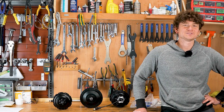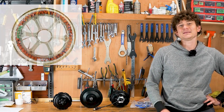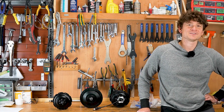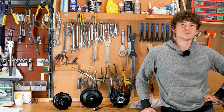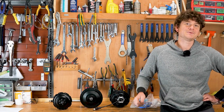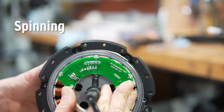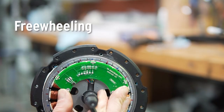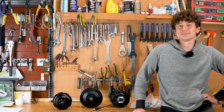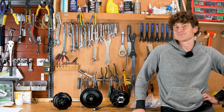The world of e-bike hub motors is broadly divided into geared hub motors and direct drive motors. In any pros and cons comparison, you learn that geared hub motors freewheel — meaning when you're riding without using the motor, the hub spins freely without turning the motor inside it, so there's no parasitic drag. That's an advantage when riding without assistance, but a big disadvantage if you want regenerative braking.